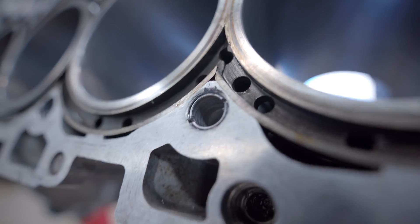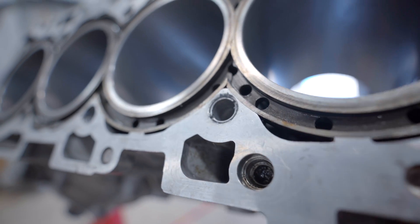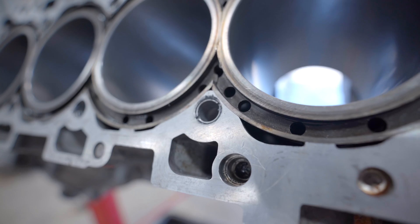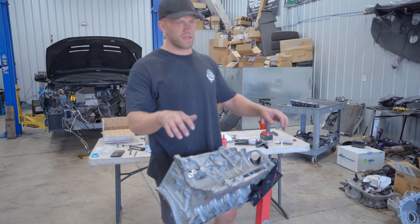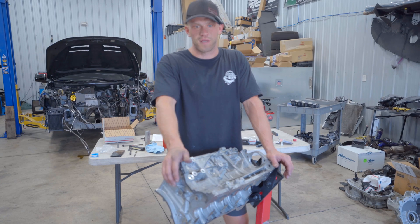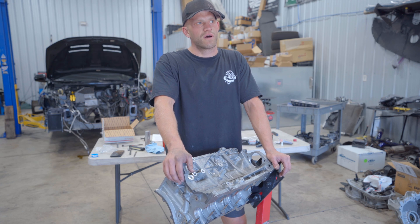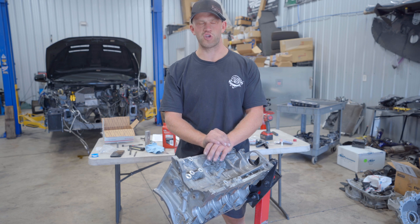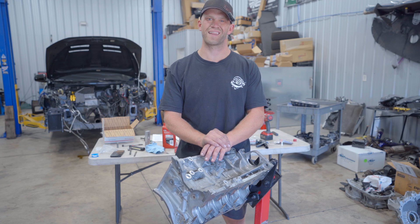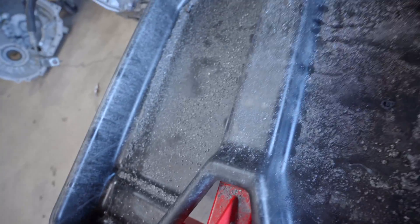All finished — it should look like that. The head of the insert cannot be poking out above the block surface; if the bottom threaded insert is installed properly and deep enough, it should sit just like that. I have no doubt we'll ever pull the threads or inserts out of this block again. I'll link the kit I used below. Also, here are all the metal shavings from drilling and tapping all the holes — that would be a lot to manage with the motor complete and in the car.